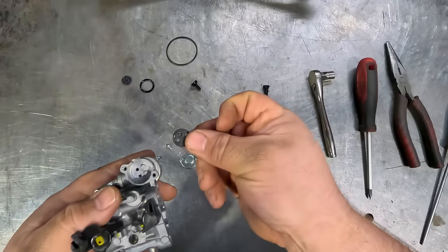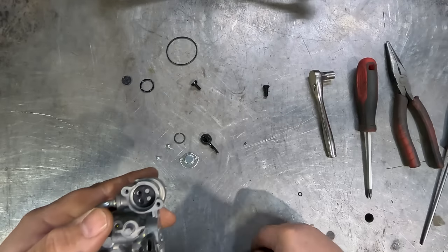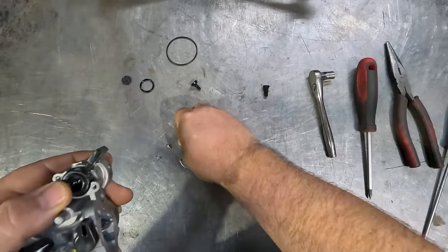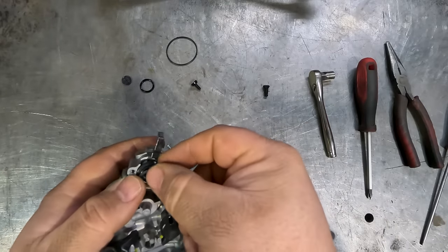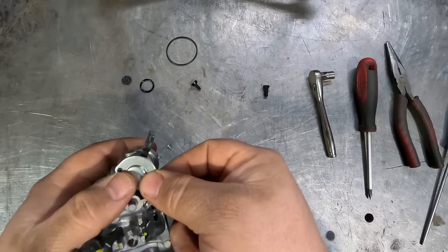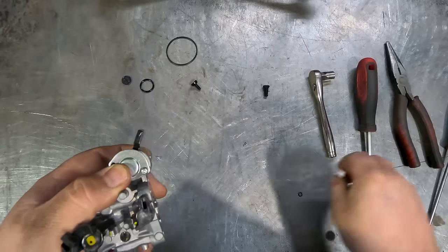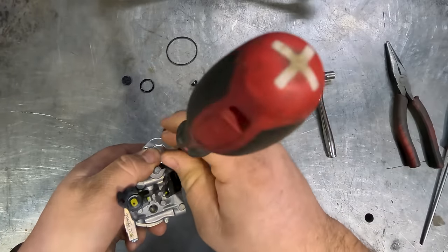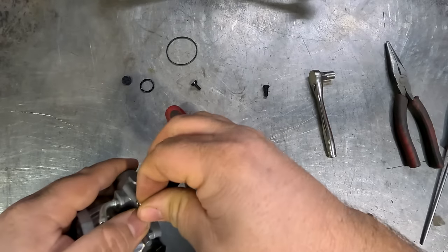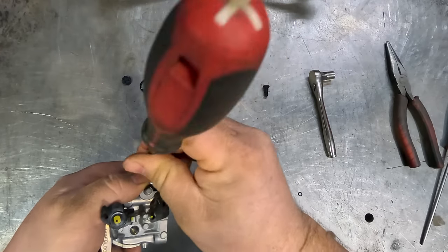We'll now do the fuel tap. That little rubber washer goes in and sits down into place. The little fuel handle sits in, the spring washer sits on next and just sits over the little fuel handle, and then the little plate just sits on top. Two little Phillips head screws hold it all together — pop the first one in without doing it up all the way, then pop the second one in, which makes life a lot easier, and now you can do them both down.